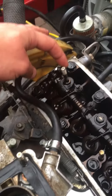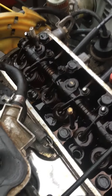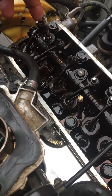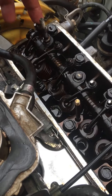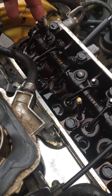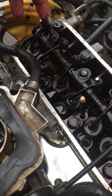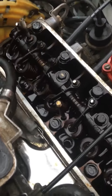The ones that I've marked here in white are the exhaust valves. With it being an 8-valve engine, there's 4 exhaust valves and 4 inlet valves. Now, the exhaust valves on this engine — this is an old engine that's designed for leaded petrol — and what I've found was exactly what I expected: the clearance is far too tight, because this engine is suffering with what's known as valve seat recession.